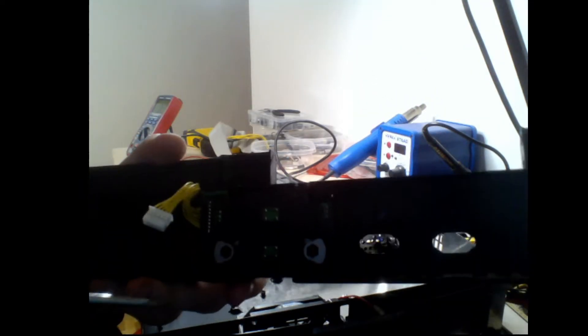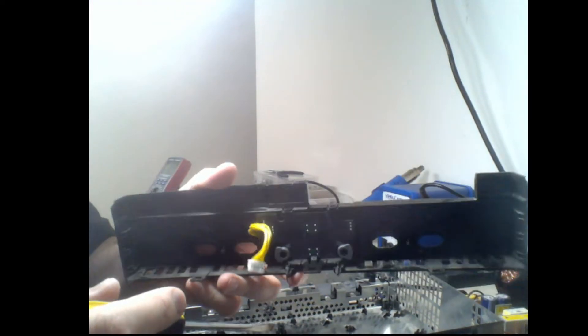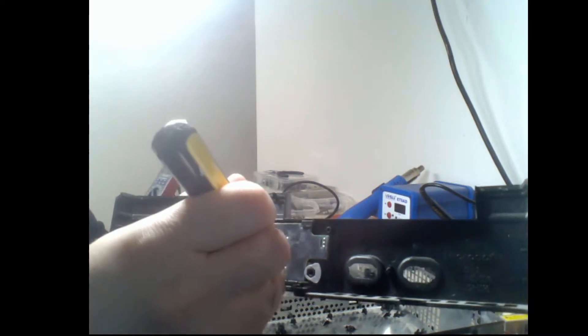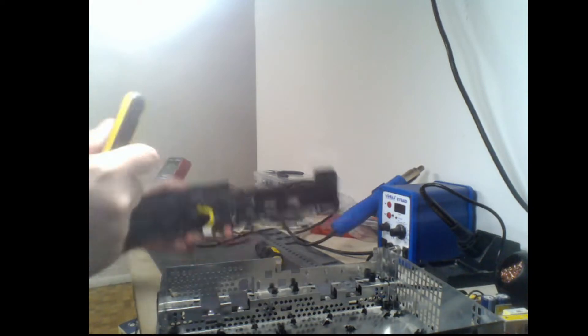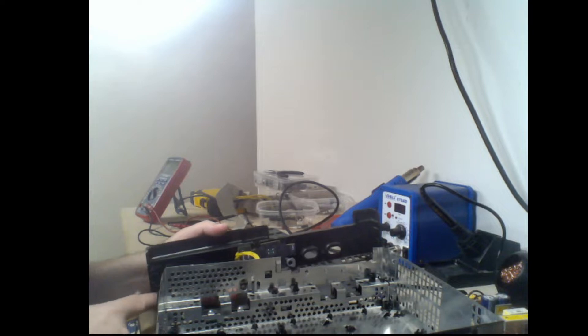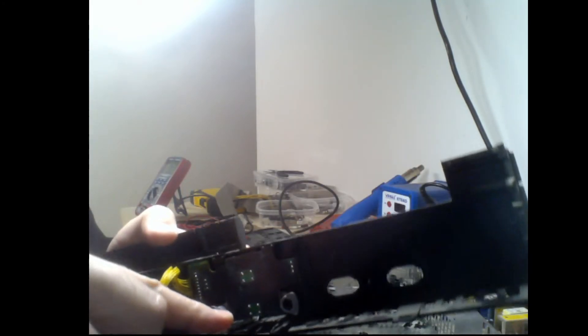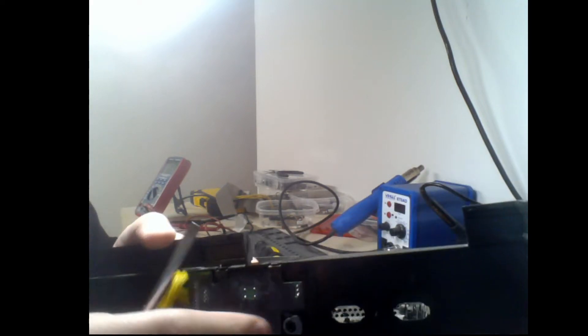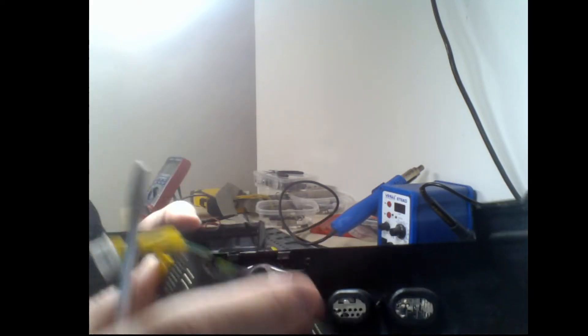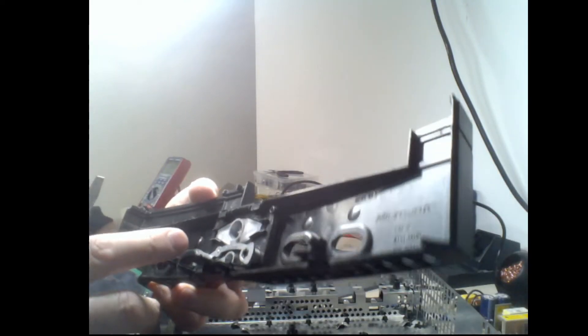See this little tab down here? Let me get a light over here. You can get this little tab — you're going to push it down gently with a screwdriver. Don't just rip on it. Same with when you're pulling on the side here — you saw how little pressure it took. It's just this little angled bevel right here, and all you need to do is pull on that and it comes right out. You push this down, and see how the circuit board just literally sprang forward? That's it. That's all you're going to do. You do not have to take the front of this off — I've seen so many people say you need to take this off. That's it. That's pretty simple.